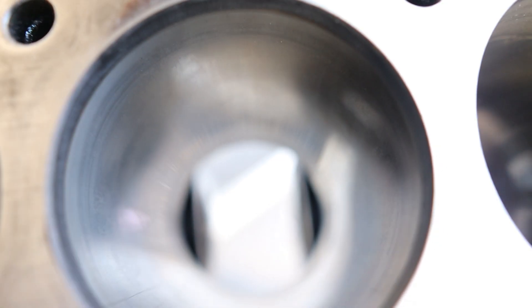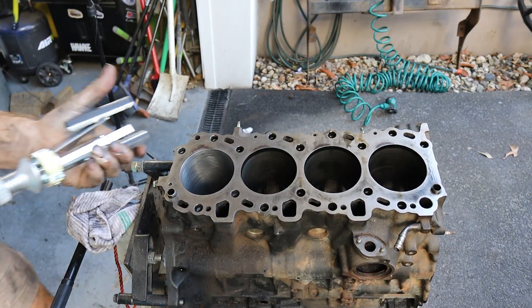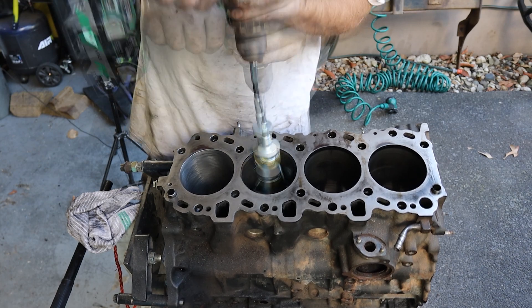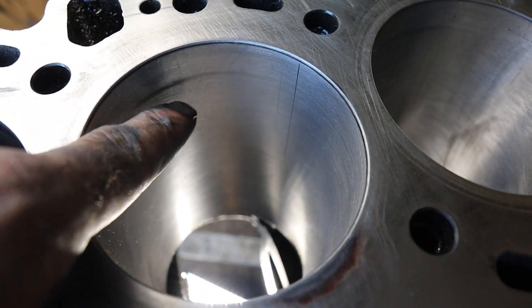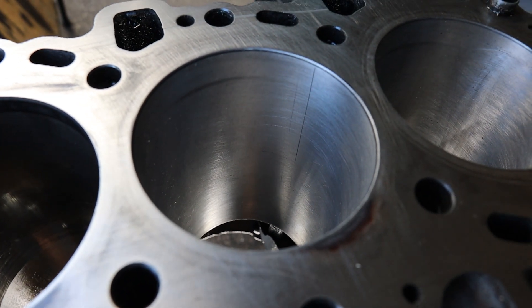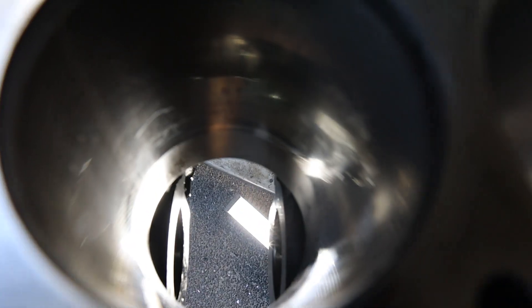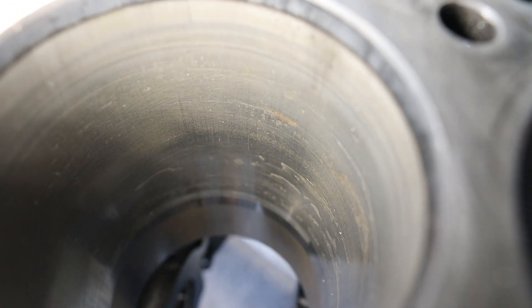You can see how these look a lot more polished, whereas this has got that nice cross-hatching. Let's take a real good look at this one — see all the dimples and scratches and things in it. We'll see how much of that we can get out. I've done this second one and you can still see that big scratch mark there and some scoring at the very top. We've got a good cross-hatch, but it hasn't really gotten rid of those nasty imperfections. There's a reason after all that I didn't use this block in the car anyway, but it's a good test for the tool we're using.